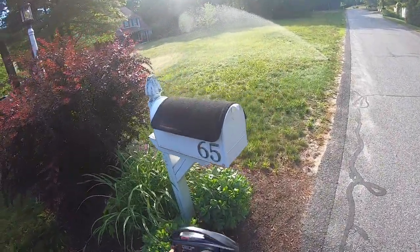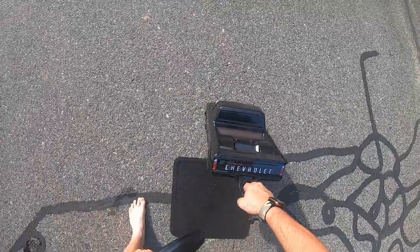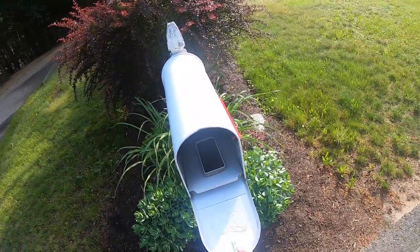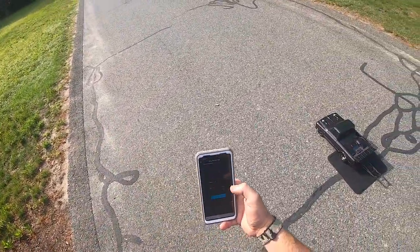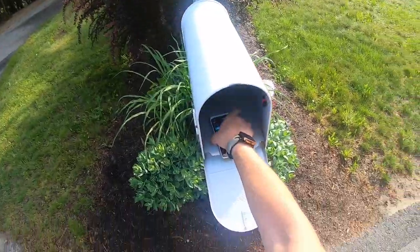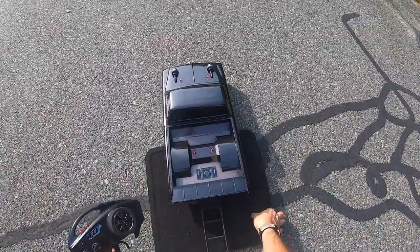Now we're running the 29 tooth on a 76 spur. So we'll see what it does. All right, we are back out. Rug is dry, surprisingly. Temperature has cooled down a little bit, but we are now running the 28 tooth pinion gear. Do want to check the SkyRC thing here. And we've got 12 satellites. I'm gonna hit drag and I will hit start. Leave that right there. All right, TSM is off. It's a 2S pack. I did top it off.